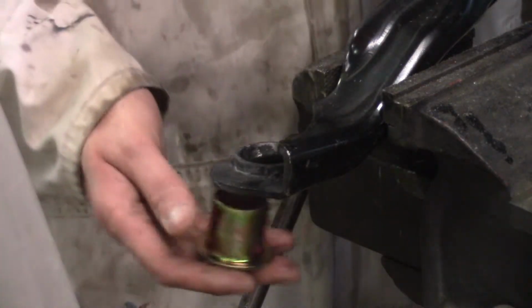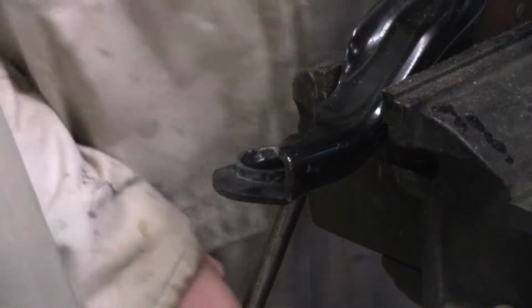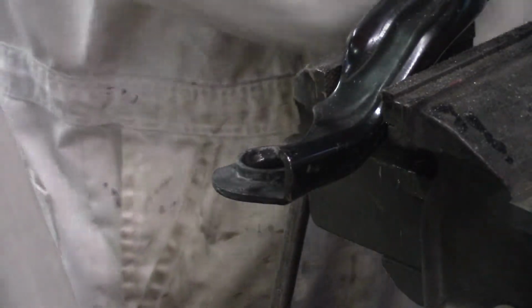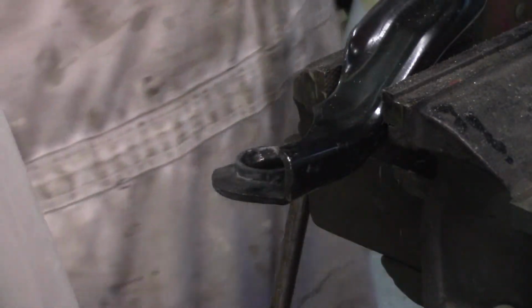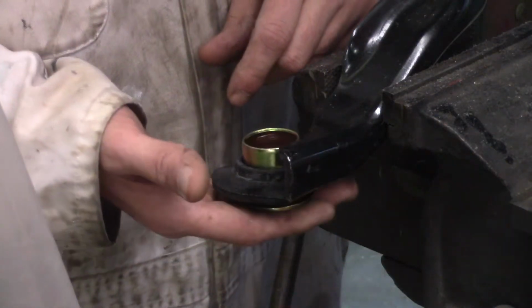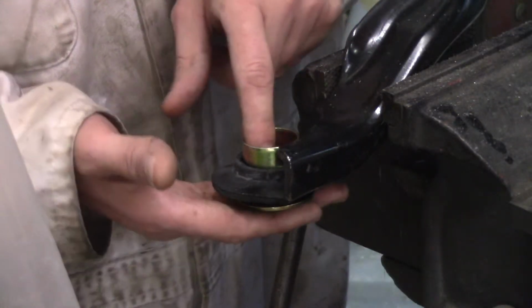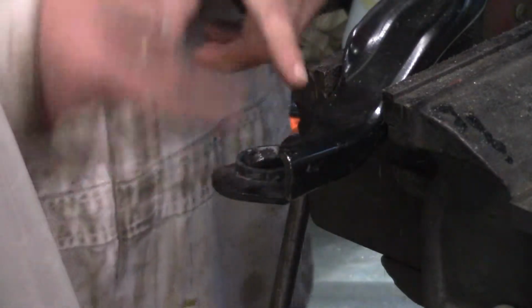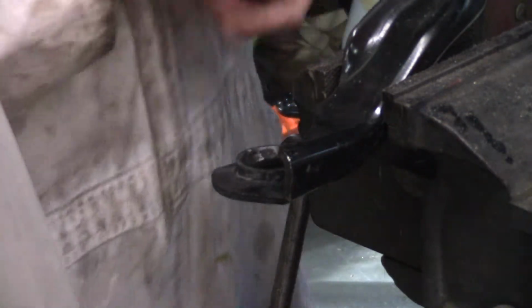What I forgot to mention was that part of making this shrinking project work is that the material has to be quenched. So when it's hot, you quench it, and then it'll shrink itself into place. Theoretically. So this side, and I can see through here, is pretty close, this edge. But what I'm going to do now is flip the piece over and put that back in there.